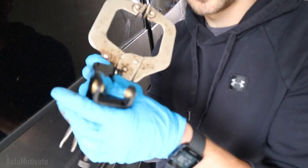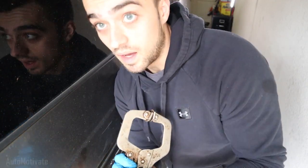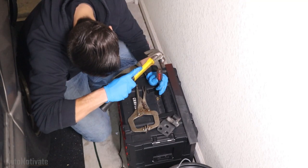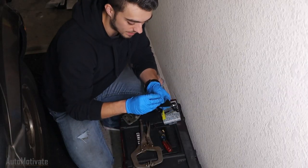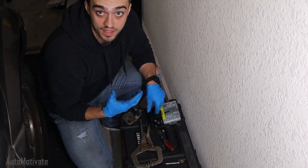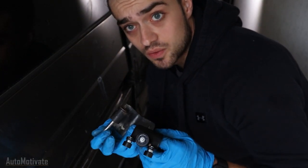This was sold as a factory replacement for the Astro. However, these bolts are sticking out too much and the plate is on the opposite side. I'm just going to try to make it work. Got one side out — okay, all out. That fits perfectly. Then I tried to see if it fits well, but the holes are too big. What needs to be done is get a washer that will fit perfectly so it can sit snug. Let's see if this is actually going to work.